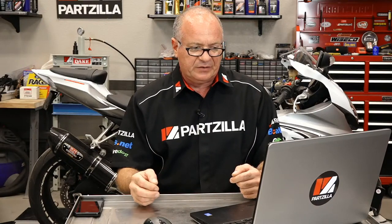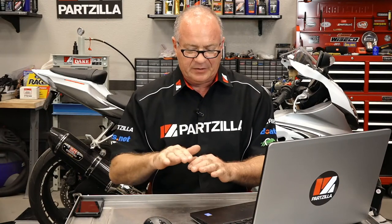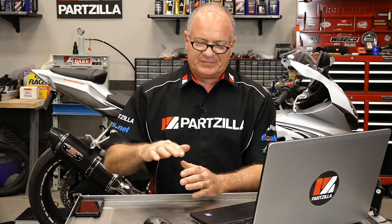And I think we did a video that actually shows an inspection and what to look for when you're trying to evaluate the sheaves as to whether or not they may need to be replaced. And if they have a real glossy sheen to them, you may need to go back with maybe some 800 grit sandpaper and just take that edge off where they'll grab the belt more effectively. So go back and take a peek, then let me know.